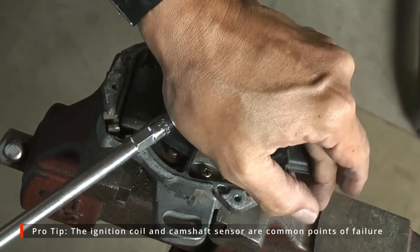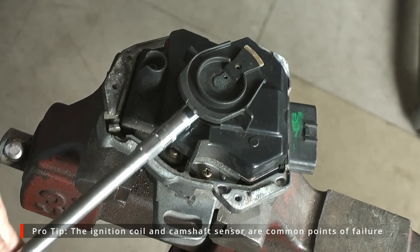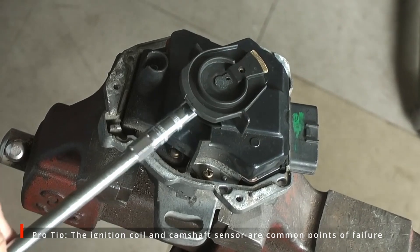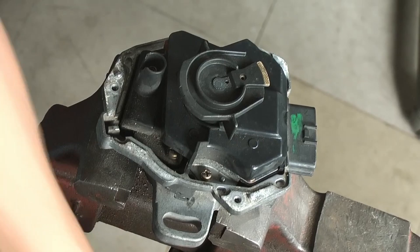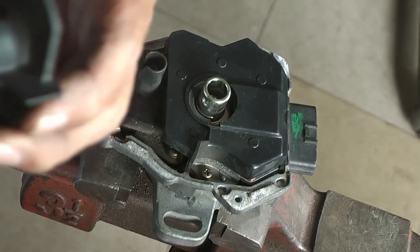Note that it is usually the ignition coil with part number CMIT227, or the camshaft position sensor with part number RSB57, that will usually malfunction. The mechanical parts usually last longer.